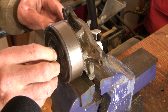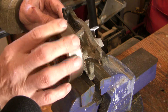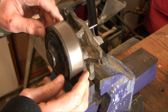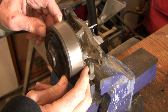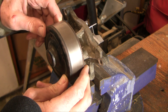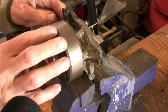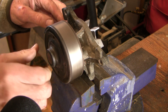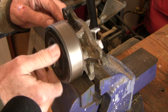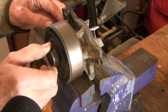Now that the water pump is off the vehicle, let's have a closer look. It spins fine, but if you tip the pulley off axis — listen to that clicking sound. That's the same kind of test used for wheel bearings: you tip the wheel off axis to look for any movement. That's all it took to make that loud clacking sound. In this design the impeller has a very tight fit inside the housing. There are no witness marks on the blades, but I wonder if it was making sidewall contact.